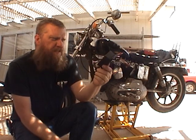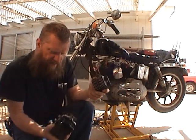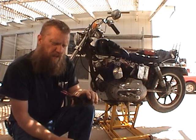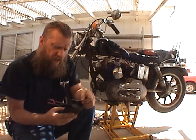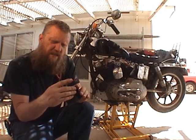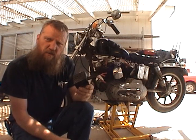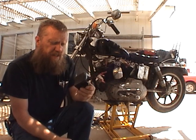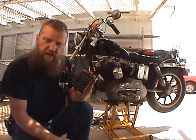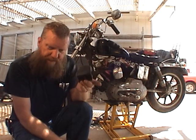This is the voltage regulator — a solid-state voltage regulator that uses a transistor, not like the old relay type. I remember a few years back running into a backup whole-house generator that was killing its starter batteries. The unit was about 20 years old, and the voltage regulator on these small engines is often continuously connected to one side of the 12-volt battery — in this case through the red lead. When these regulators become old, they can start to drain the battery back through the regulator. Knowing that, I put my hand on the voltage regulator and it was hot after having the battery connected for only 20 seconds. Bad voltage regulator.